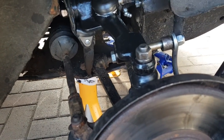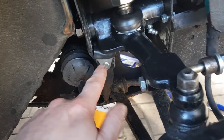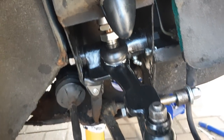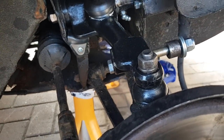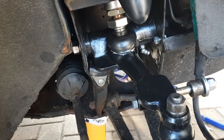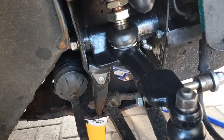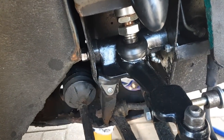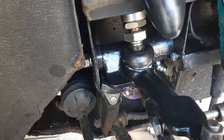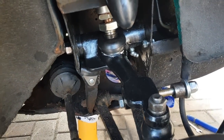That part didn't record, but as you can see most of it is in now. I've got the bump stop in - that was just the screw that goes in here, polyurethane same as the top. It took quite a bit of fiddling to get everything lined up because the rubber cone had to be compressed quite a bit. The cone was held in place compressed, then I got the hi-lo in and fed the arm with the knuckle joint up into position, got it lined up, knocked through, and got everything tightened and torqued up.